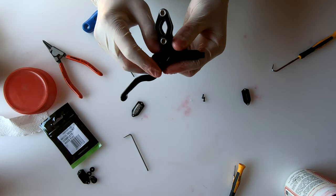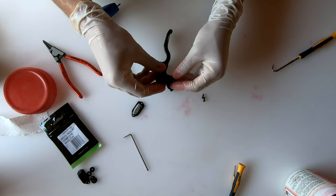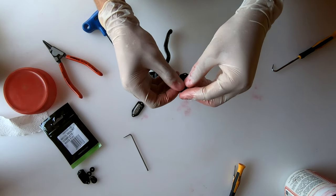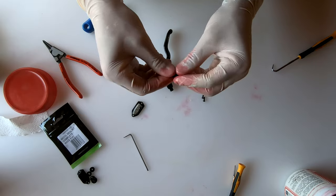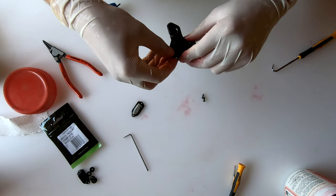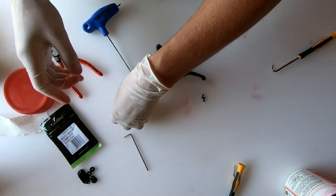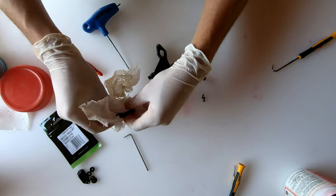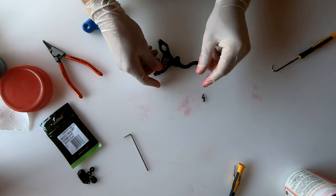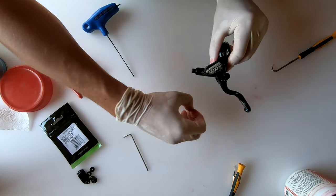The snap ring is on. For the top side, this seal sits submerged in DOT fluid and doesn't experience oil pressure, so just lightly grease the lip on the outside where it sits under the reservoir cap — you'll see it sits in there nicely. Now put on the cap; you'll feel it slots into place. Then replace the two T10 screws.